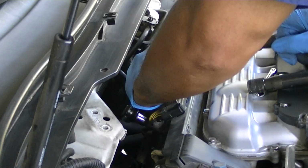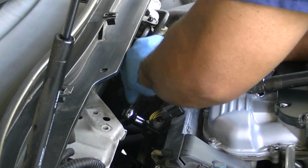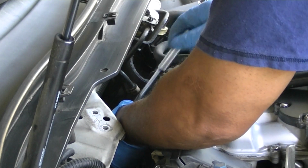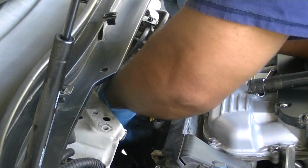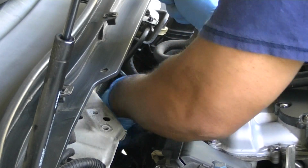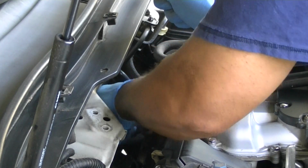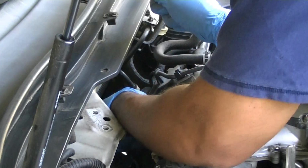And everything is, remember, loosey lefty. So you turn it to your left, pop it loose, break the seal, crank it a few times. And then what I like to do is, once I've got it semi-loose, take the socket off and then twist it out by hand. It just makes it easier and convenient for you. Once I feel it's completely loose, and you can tell it just literally will fall down on its own. It takes about 15 turns.